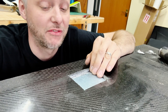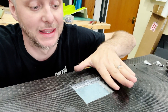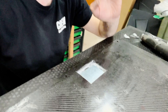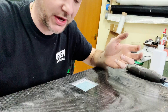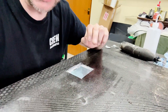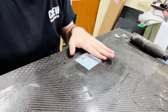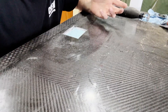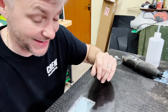We're going to fill the top with a forged carbon type material. We're going to mix resin, get lots of chop strand, and basically fill it so it's nice and level. Since this is not a visual part — it's under the car — we don't actually need to make it as pretty as the parent material. It's function over form, and it will still look carbon-ish. We're just going to fill it completely, sand it flat, and in the end you'll get the aluminum plate on the inside with carbon on top.